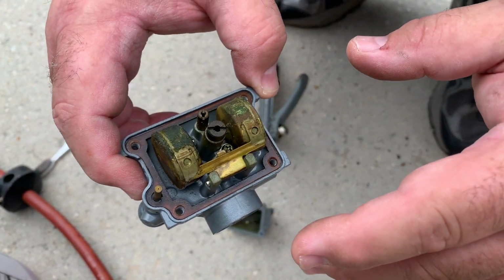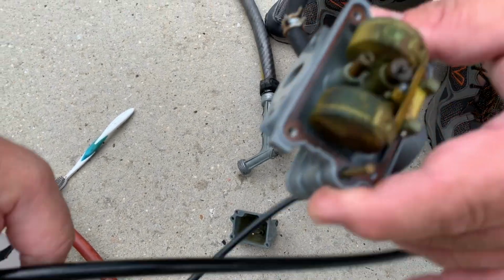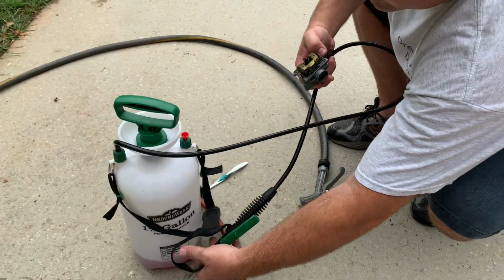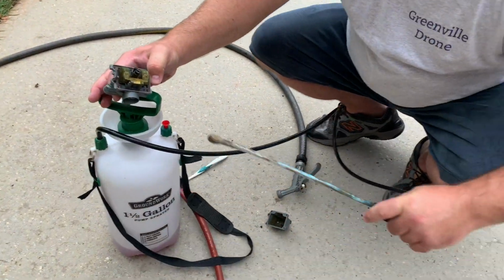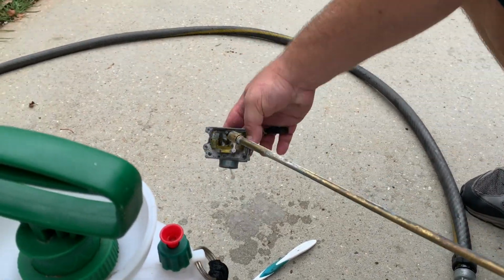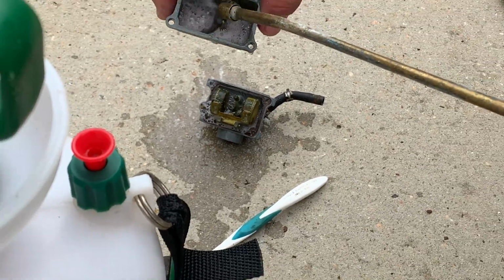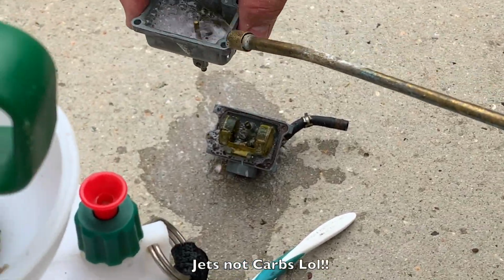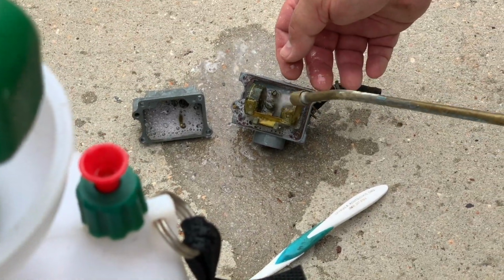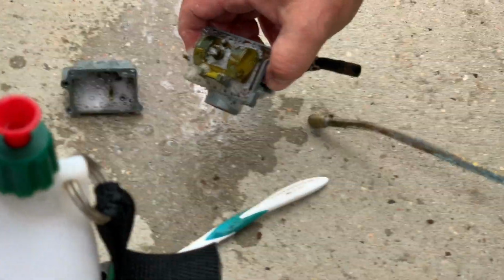Now I don't have the most efficient way of doing this, or do I have a can of carb cleaner? But if you've watched my lawnmower video, I am a fan of Purple Power. Purple Power basically eats the gum right up. Now, we're still gonna use some pins to get those carbs taken care of. If you've watched other people's YouTube channels, they have little sonic cleaners with Purple Power mixed in with it, and the reason is because of the way this dissolves gum so well.